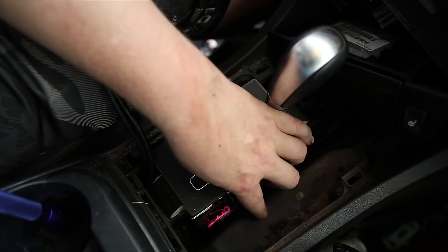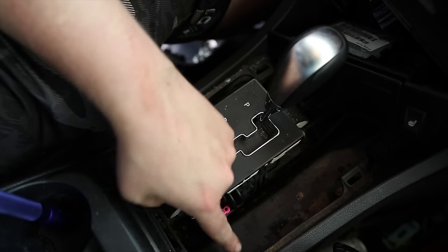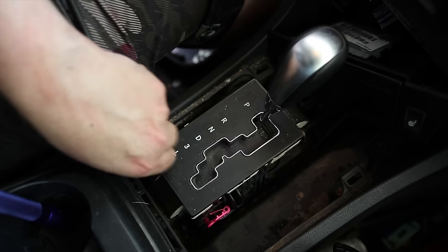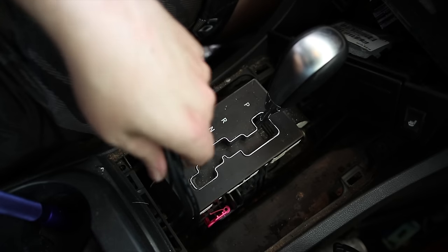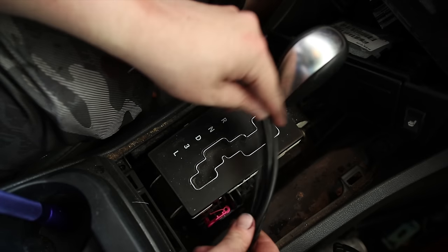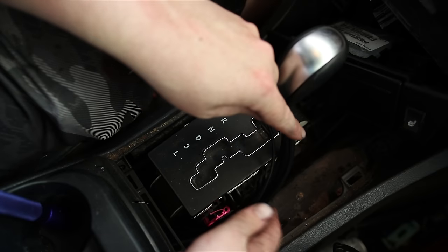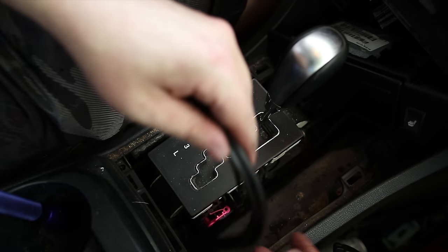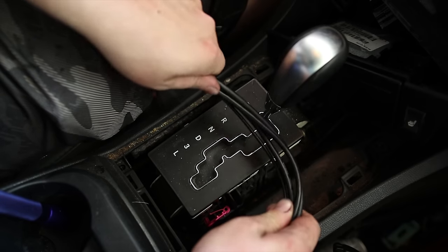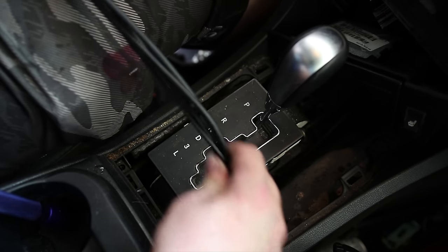And this is just the tube that blows hot or cold air to the rear. So if we run it underneath this, we should be safe with the other wires. And I want to tape these up, but if I do, I might not be able to fit it underneath here very well. So I'm going to try to push it underneath and then tape it when I get past that, so that they all stick together. So I'm going to start about here, and I'm going to tape these up.